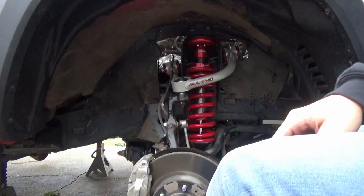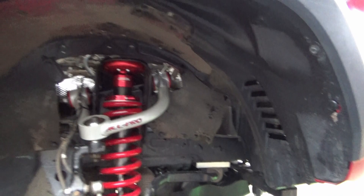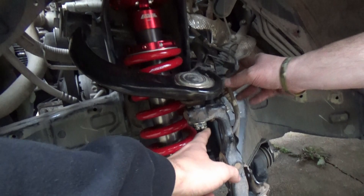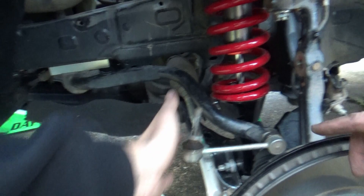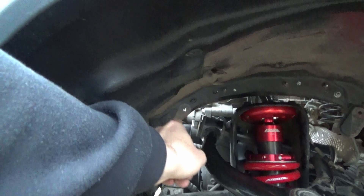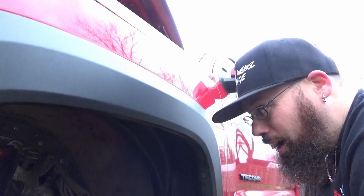Kind of the same thing over here - rinse and repeat. It started with the splash guards obviously. We took the brake line bracket off, loosened this dude up here, and cracked the sway bar. UCAs - are they easier than doing the lift, would you say, in the front? They're on par. If it was as simple as just pulling this out, this would be 10 times easier. But it's the fact that Toyota doesn't know how to design it - it literally has to be on there before the body goes on. I think upper control arms are easier than the coilovers, but more finesse is required.